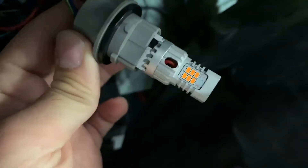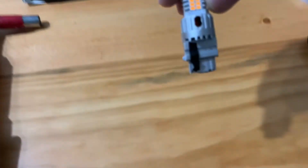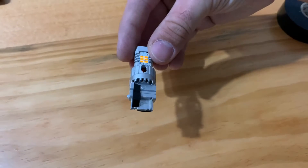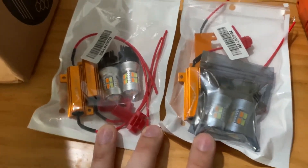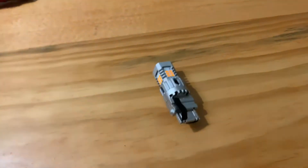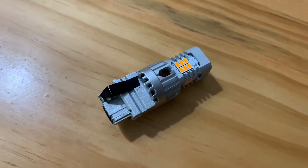I'm going to pull the bulb back out so you can see what I'm doing with the tape. When it's in the adapter, it only really touches the side, so that's what you need to cover up. Looking at it, the opposite side for each wire is how I've done it. I have some other 3157s that don't have built-in resistors — those are switchbacks — and I thought I was going to have to hook those up instead, but I was hoping to avoid that. So I've done this tape trick to make the car think there are no parking lights installed.